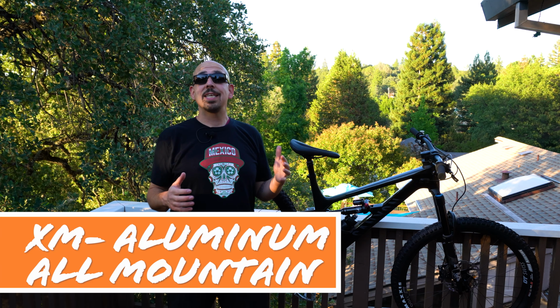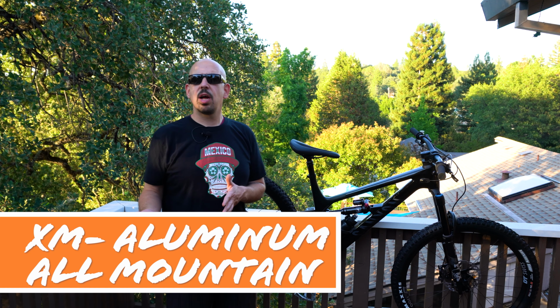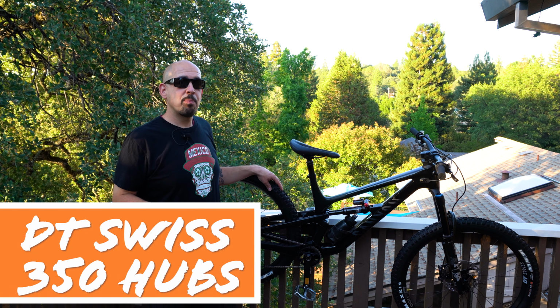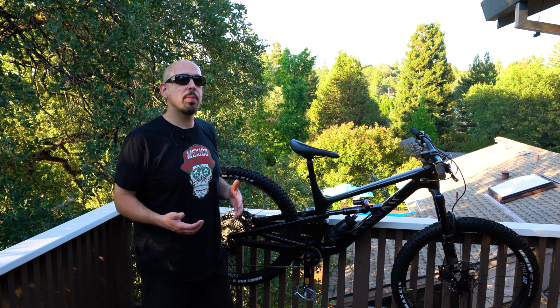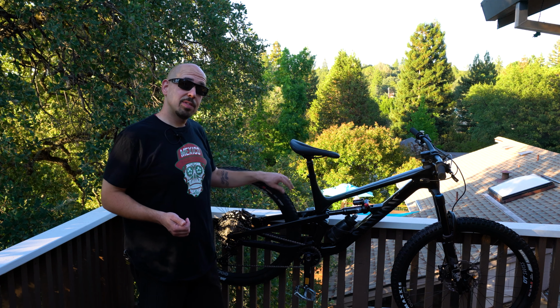And then the wheels, it has the XM 1700, so that's a nice upgrade from the lower version, which I think has the M 1900s maybe. These are going to be a little bit lighter, and they're the welded rim instead of the sleeve and pin, so you're going to save some weight. And the rear engagement on these 350 hubs, they have the 36 tooth Star Ratchet, so you're not getting the 18 like they used to back in the day, so you're getting a little bit better. I know you can upgrade it to the 54 tooth, which I might do because I have some laying in the garage.